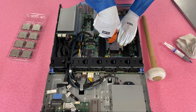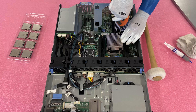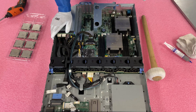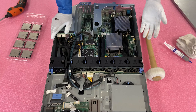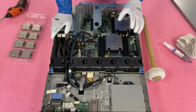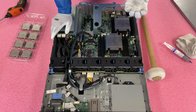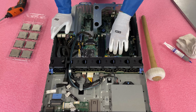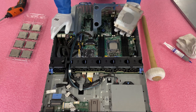Be careful — push down hard enough but not so hard you're jamming it into the motherboard. When you lift the heat sink up, you don't always know how much thermal grease is underneath. I recommend lifting slowly and straight up so any dry, flaking thermal paste doesn't scatter all over your board. Luckily, this one doesn't look too bad.